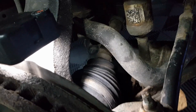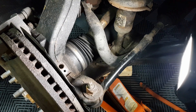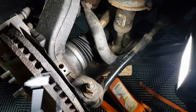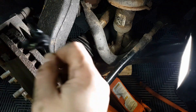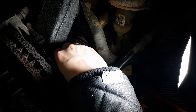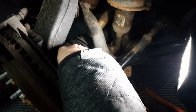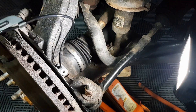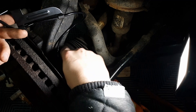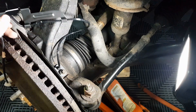What we're going to do now is fit the new sensor. If your sensor came out in one piece — lucky you — you will rejoin the video at this point. We're just about to fit the new sensor. Just going to slide that in, being careful not to put any undue pressure on the cables. It's a firm fit, and once it's in, replace one of your 8mm bolts — get it finger tight to start with and then finish it off with your socket.